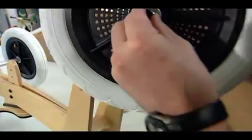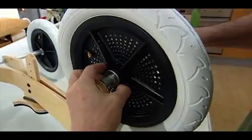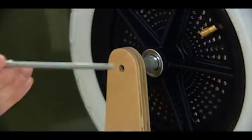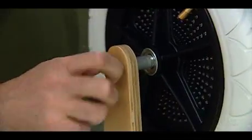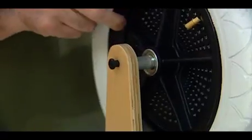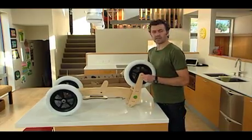You've got your front wheel assembly bar the bolt. We're going to drop that in between the forks and gently lower that into place. Once we've got the front wheel in place, the next thing we're going to do is put the threaded rod through the centre. Drop that in there, start with finger tight, and then finally get our Allen keys, do it up nice and tight, and you've got a front wheel.